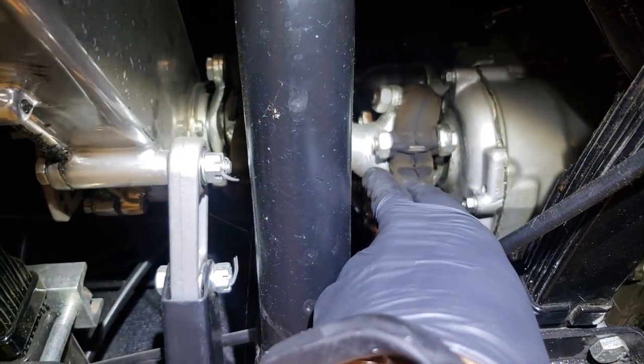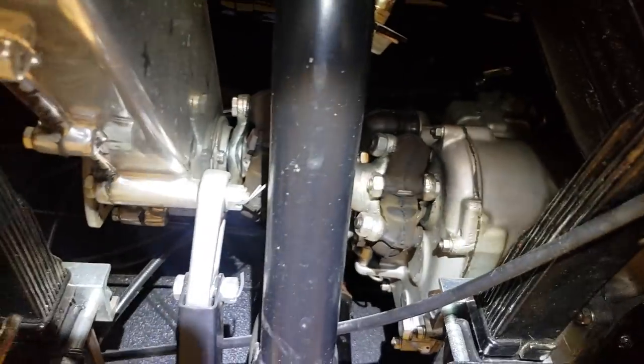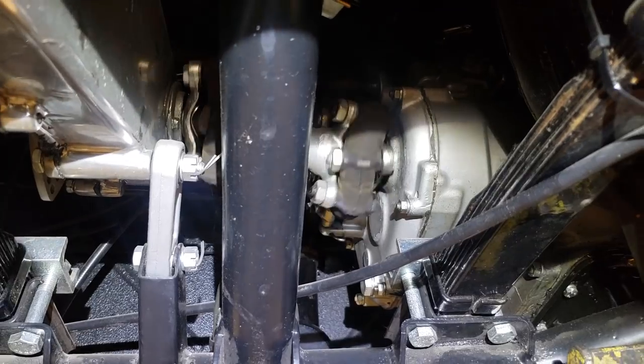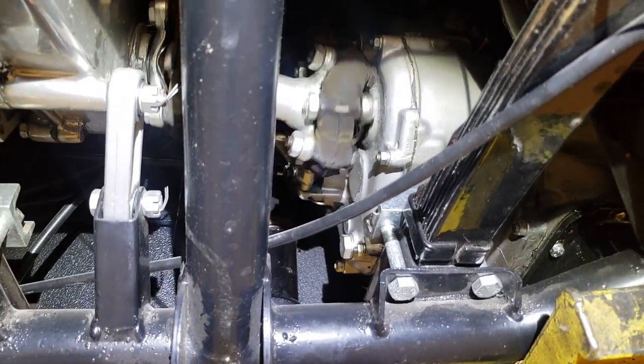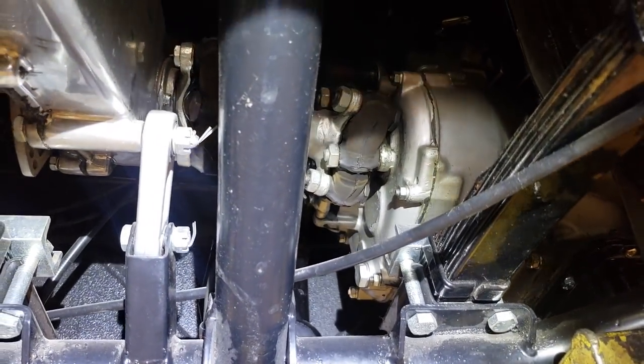This is your transmission. This is a short little stub shaft of a drive shaft, and there's what are called Guibo — they're rubber insulators. When you rotate the drive shaft, you can see how it has to be able to flex with ease. I've done another video on Isetta on how to upgrade those to polyurethane ones and line up that drive shaft for less rolling resistance.